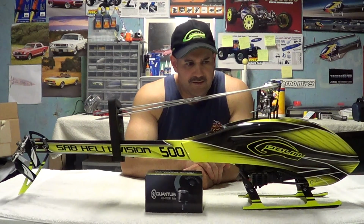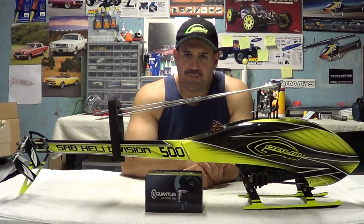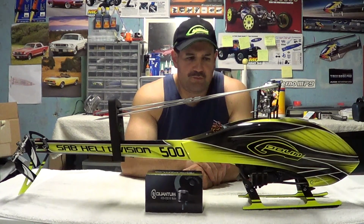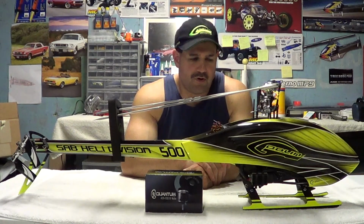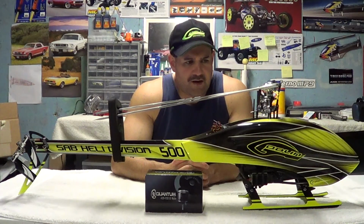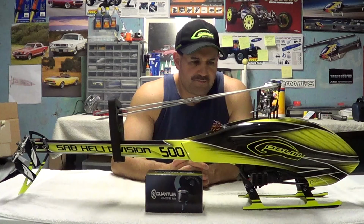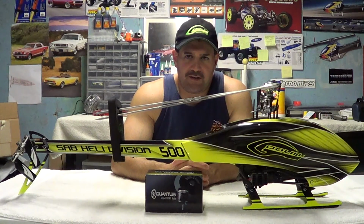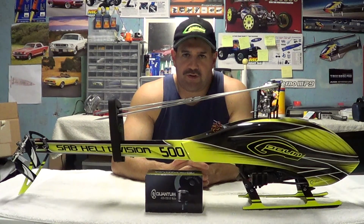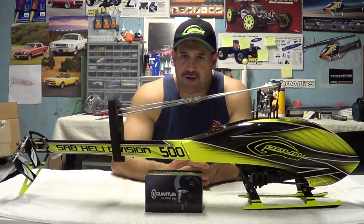And I was getting problems with the Talon 90, kept getting a beeping sound. Well, the Talon 90 had no data logging, so you were basically guessing what was going wrong with it. So Castle advised to get rid of the 90 and upgrade to something bigger. So we put the Castle 130 on here, and went out, was having the same issues. Now we had the data logging so we could check what was going on.